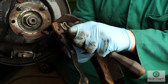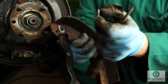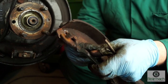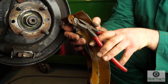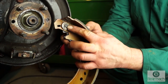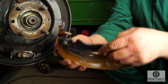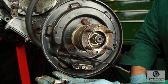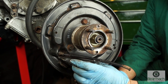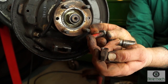Once the C-clip is off, remove the springs and everything else underneath, including the spring washers — two of them. Then remove the lever, ready to fit on a different handbrake shoe. Don't forget to lubricate this before you put it back together. I've put it back together — putting the clip back can sometimes be a struggle — push it in until it clicks into place. We have the trailing shoe edge at the top where the pivot should be, and the pivot operates okay and isn't too loose. I've lubricated the wedges for the adjuster with a special ceramic compound — you could use copper slip, however copper slip tends to attract dust. The bolt itself doesn't need lubricating as it has a locking compound on it which makes it stiff — without this the brake would simply wind itself off.